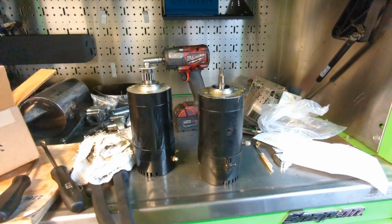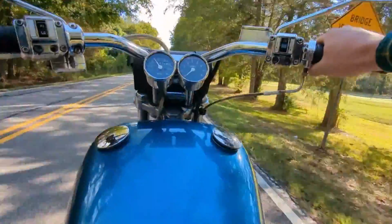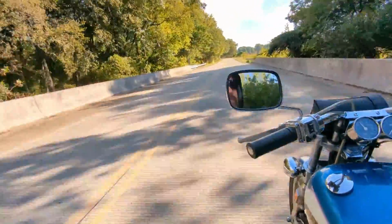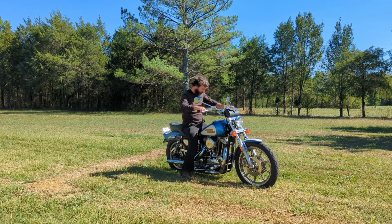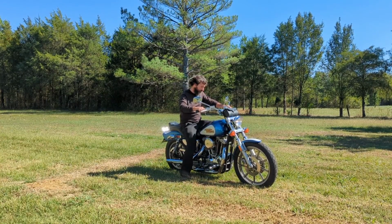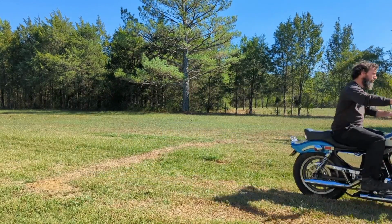So after getting the motorcycle running again, I decided I was going to do a video about daily riding an Ironhead Sportster. Can you use one of these as a reliable commuter now in 2022, almost 2023, when the youngest of these bikes is a 1985? And I made it a total of 48 miles before the bike broke down on me again. When it broke down this last time, it would run fine, but would pop through the intake when it was cold, or when you gave it some throttle. Almost like an accelerator pump issue with the giving it some throttle. And that brings us up to where we're at now.